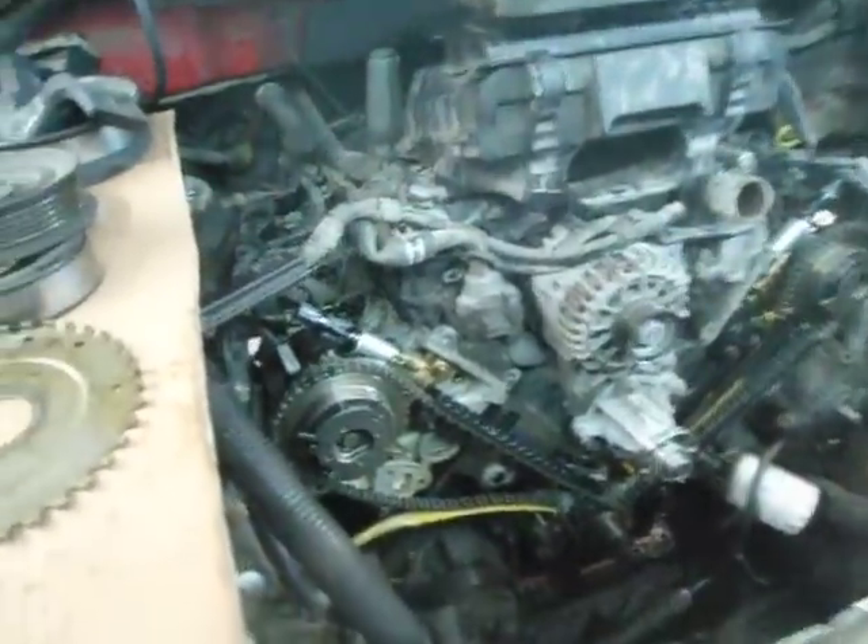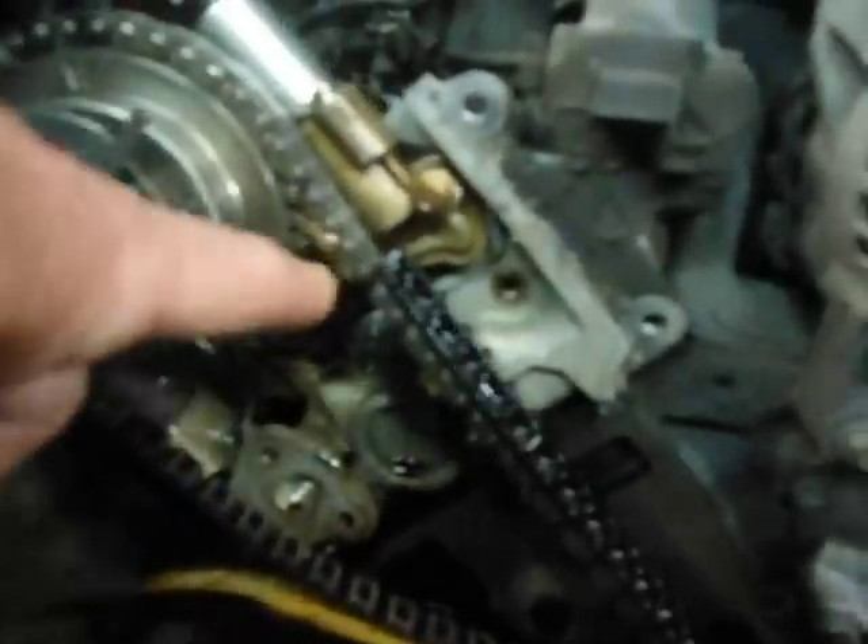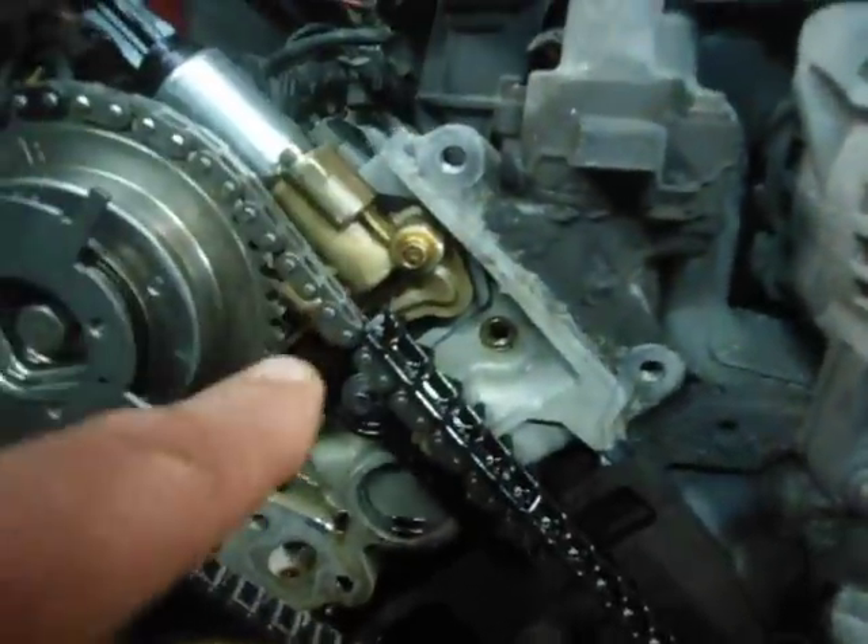We're deep into your engine here, Ken. What Steve found, after we diagnosed it, there was an issue with this cam chain on the passenger side. This bolt right here that holds the long tensioner — where was the bolt sitting, Steve? It was sitting right there with that shiny spot. It hadn't fallen into the engine, which was amazing. So this was loose.